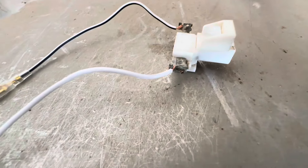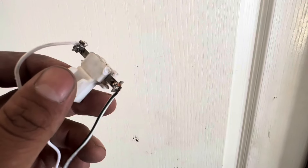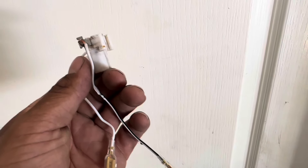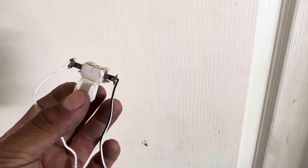What I'm about to do is make an adapter. This is the original plug off the old speakers — they just clip on and off. This is the wire that came with the new rear speakers, for which I didn't buy adapters. I attempted to solder the little connections on — melted my fingertip too. I melted the solder that was already on there and moved it to attach to these. I'll bend the tabs over and dab some liquid electrical tape on it. These will work out pretty good.